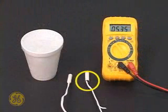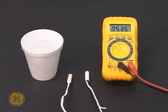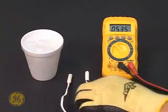Some thermistors were found to be consistently out of range. You can physically identify these thermistors by the casing of the bulb. Notice a dark sealant where the wires enter the bulb, as circled here. Another indication is that the top of the bulb will have a rounded head.